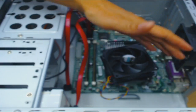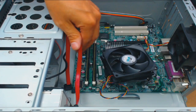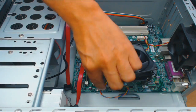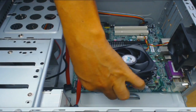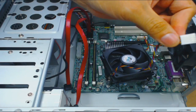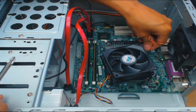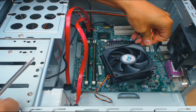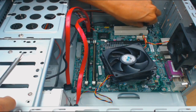For this I don't need to take it all apart — I just want to show you quickly how to take out the motherboard. Unplug these power cables. Here's a power cable for the CPU fan, so I'll take this one out. Don't forget any power cables, don't forget any cables. Here's another cable for the case fan — they just come right out. And here's the HD audio cable back in the corner.